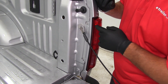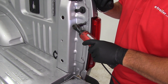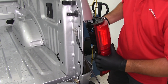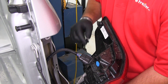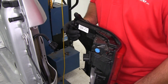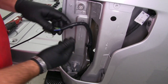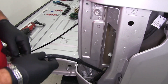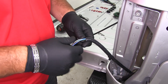To remove our taillight, we're going to start on the passenger side. We're going to remove this bolt and this bolt. Then we're just going to pry the light off — make sure those alignment tabs don't break off. Once disconnected, go ahead and unplug the taillight and set it aside. There's a little clip holding our wiring; if we unclip it, it gives us a little extra room to work with. Pull our wires out.